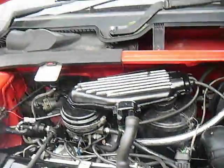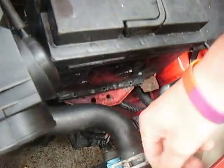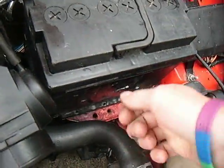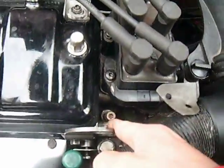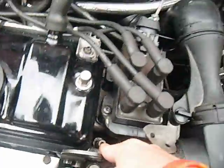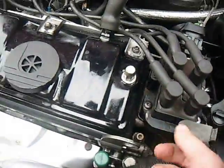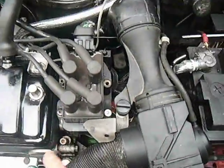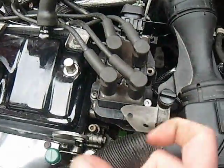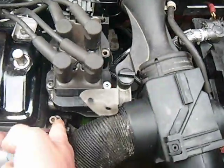Now, to drain the water out, take off the top here and top here. These are pretty tight. What you can do is go with a pair of pliers or put a spanner on it, which is the right side. You can just turn it around like that. And the bleed on the top here, you can undo that. It's like a banjo bolt. It actually has holes through. It has a hole through the top and a hole through the middle. So when you crack it loose, the air should bleed through it. But that doesn't always work because they fill up with gunk and things. So you can just take the whole thing out. Just don't lose the copper gasket, otherwise you'll be in with a problem.